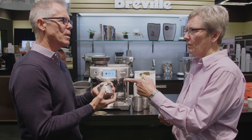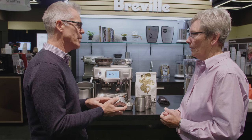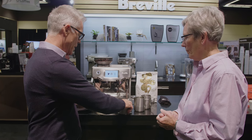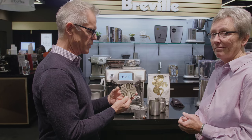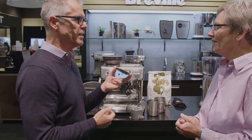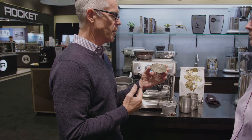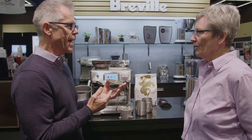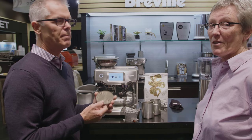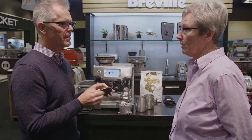This one takes only about two minutes to warm up. The dual boilers take about seven minutes, the Oracle about seven minutes as well. We've used a brand new heat system in the Barista Touch — the ThermoJet heating system. You can see it's extremely thin with very small thermal mass, so it's very responsive to changes in energy and the temperature required.